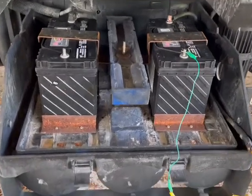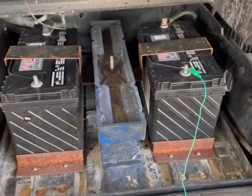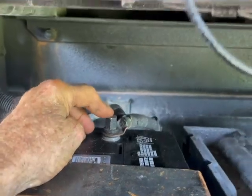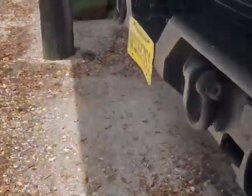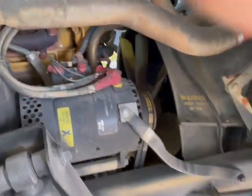Having the batteries in — and in the middle I put that plastic piece, which gives a tray while you're working in the area. Now, how can I verify that I've got 14 volts and 28 volts and that my wiring is correct? I've got what I suspect to be 12-volt positive back here and 28-volt positive over here. I can verify this by running one battery to ground on the 14-volt side and going to the alternator or into the cab to touch the 12-volt side and see that I have a light. That verifies the 12-volt side. I can do the same for the 28-volt side. Verify it — take the ground off — make sure yourself.